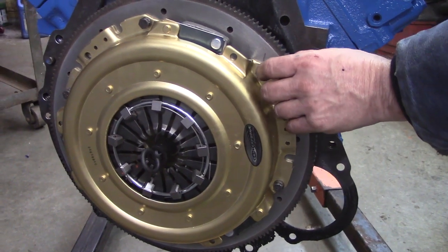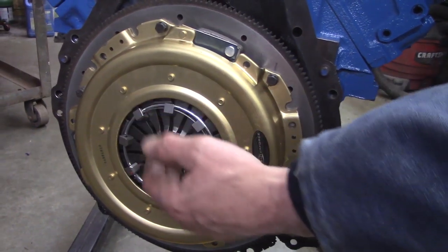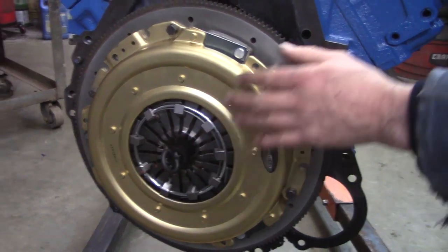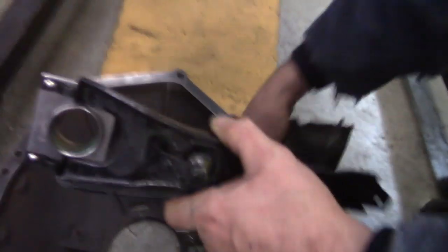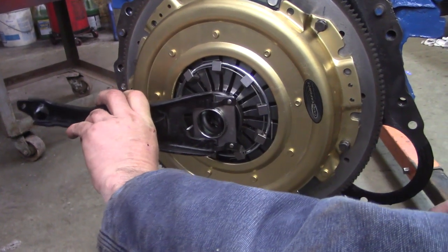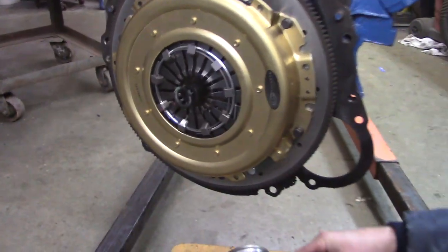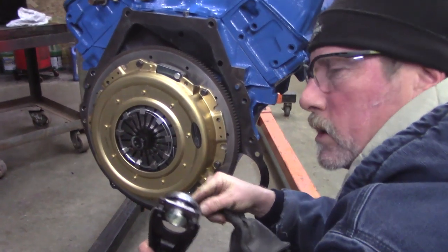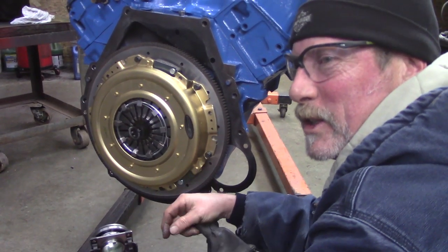As you're tightening the bolts down you're putting pressure on the clutch disc — that's what grabs your car. Then you have the pivot fork with the throw-out bearing that rides on there, and you're depressing that, which lets the clutch spin freely. We're greasing up where this ball rides. The pivot fork goes on that ball, and as you're pressing the pedal in, this spins. That's why a lot of times when somebody has a stick shift car and it's making a noise — you put the clutch in and the noise goes away — that's throw-out bearing noise, when this thing starts getting sloppy. A real pain to change these out, another reason why everybody went to automatic.